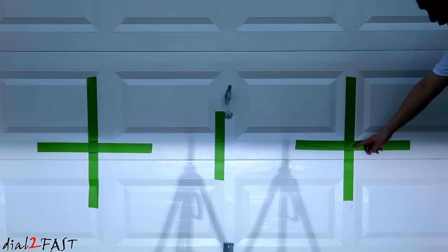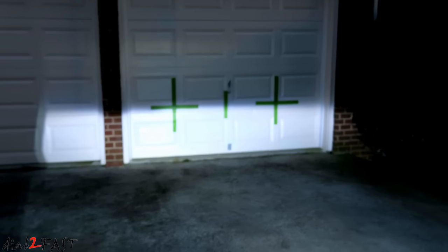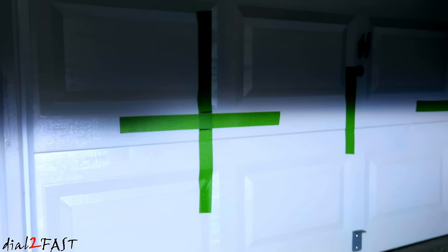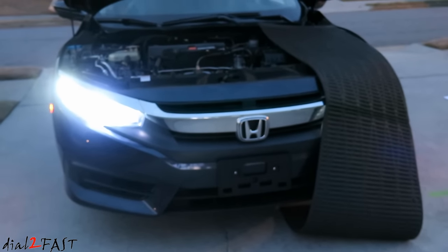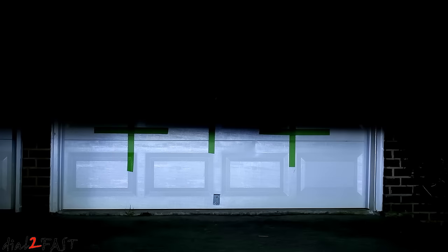For the passenger side it's pretty close — it's around the correct height. It may also help to block out one side of the headlight while making the adjustment. So right now you're looking at the driver's side light output — let's first adjust the driver's side. Then cover the driver's side and aim the passenger side. Now we have both lights properly aimed.